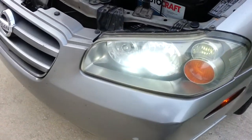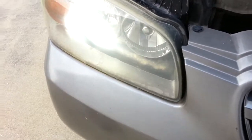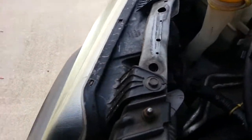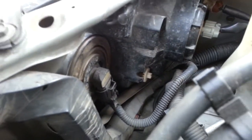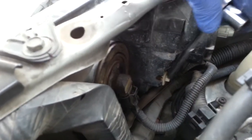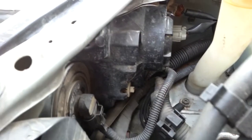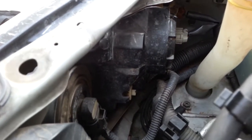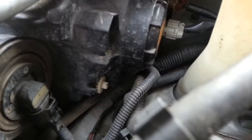Here's the light. This light here, I need to bring it up. I'm gonna show you the bolt right there — that's this one right here. So you need clockwise to raise the beam and counterclockwise to lower the beam.